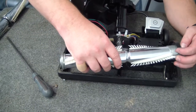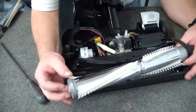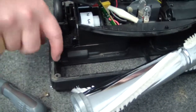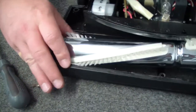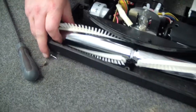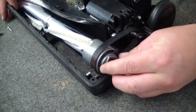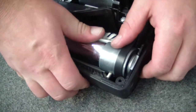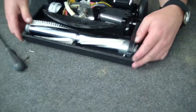To reverse it, put the belt over the little grooves. Then see this little round locator? That is going to go into the receiving hole here — that's the first part, just wiggle that in. Then on the other end, you'll notice that you've got a horseshoe-shaped locator — that's going to sit in. As you're putting it in, give it a turn and make sure everything's running smoothly.